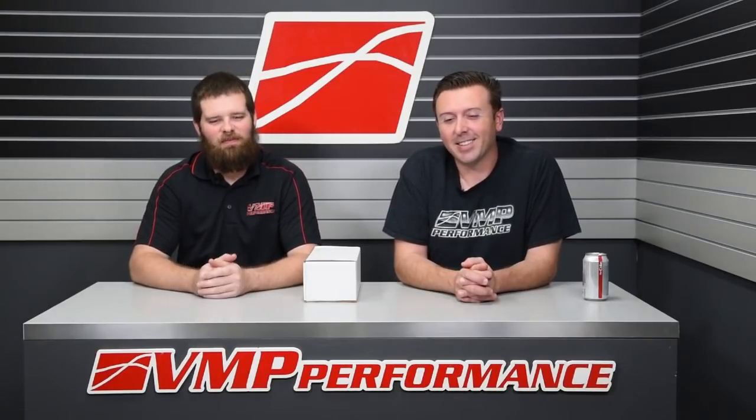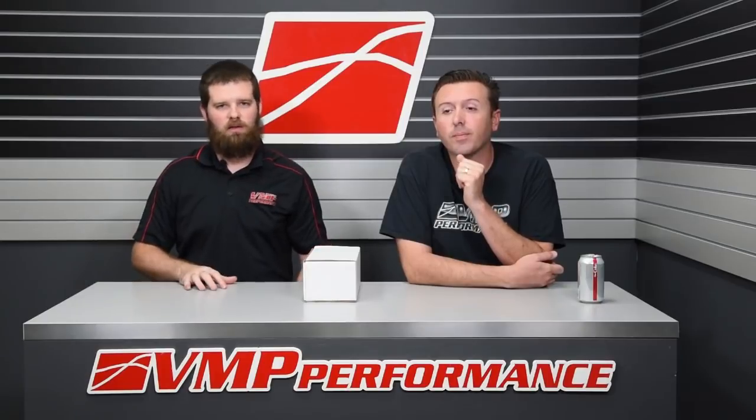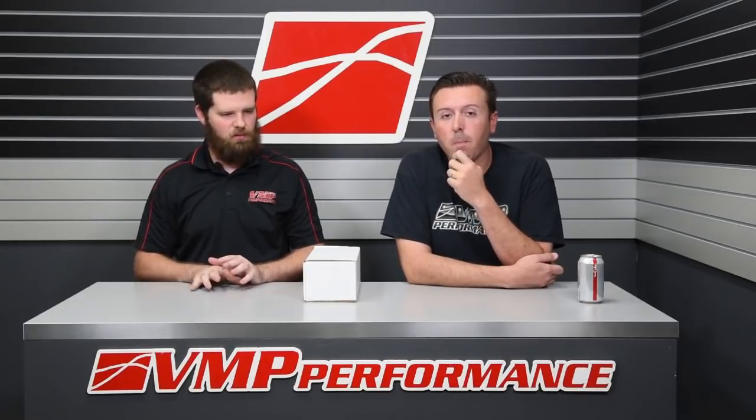In reference to blowers on Lightning manifolds, I want to say the Gen 3 would fit on a Lightning. Yeah, VMP, because I know the GT500 Trinity's Gen 3 fit. So the Gen 3 would fit, a Gen 2R, a Gen 2, a Gen 1, basically all the GT500 blowers that we sell or Ford Racing sells should fit on that.